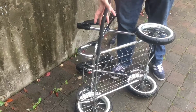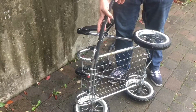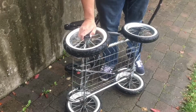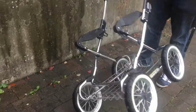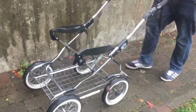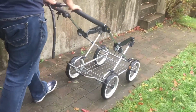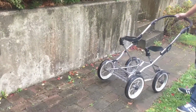You're just going to put your bar on and apply pressure, and you're just going to want to slightly bend it. Just slightly. It will be very difficult actually to see how much you've bent it by looking at it. You bend too far, you break your axle. So just slightly. Now of course, you're going to want to roll it on your test track again and see if it's still veering to the same side, if it's begun to veer to the opposite side, or if it is okay. And I've never had this thoroughly fixed on the first pass.